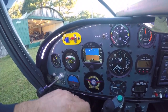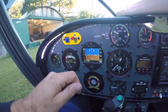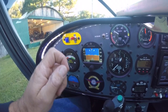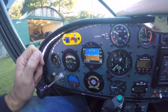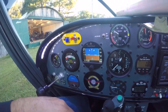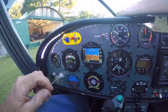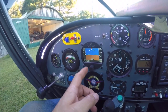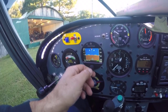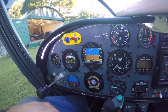The autopilot can be used for an altitude pre-select. If you know what altitude you want to climb to and maintain, you can set that ahead of time. You don't have to — you can take off and it'll act basically like an attitude indicator. But for this demo we're going to do an altitude pre-select. We'll click once to the right and set it at 2,000 feet, push in on the button one time, and that altitude is set at 2,000.